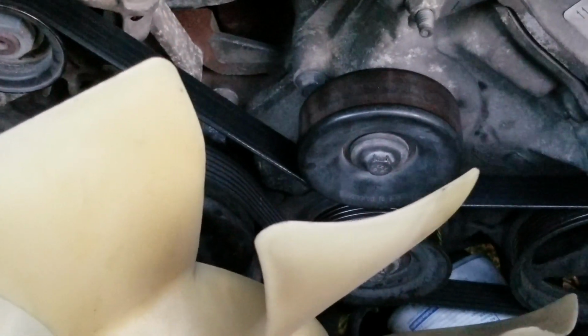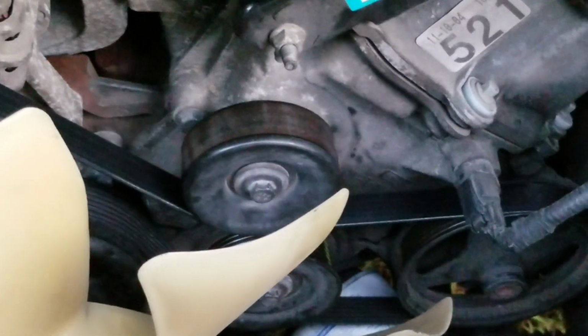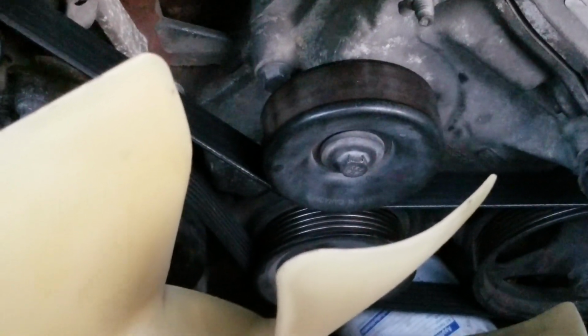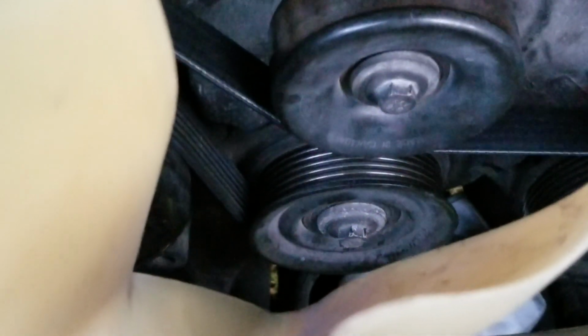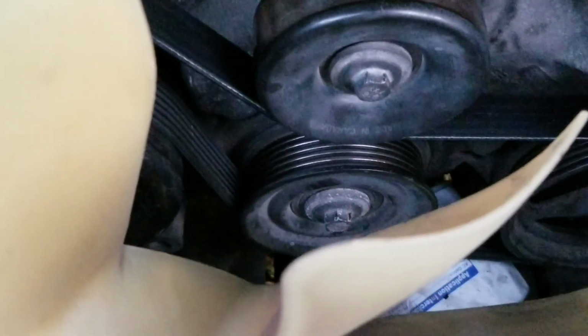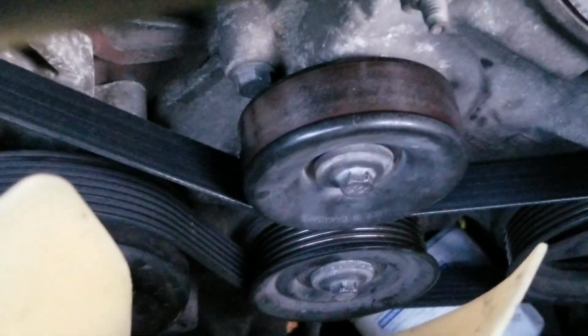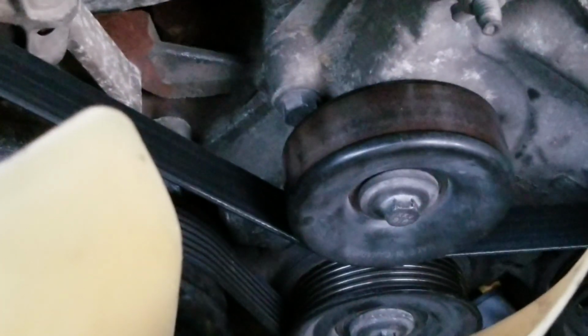But what I was going to say is, if you find a little shorter belt, like a 79, then you can take the idler arm pulley, because all these bearing races, that pulley and that pulley, all have the same size bearing seats. And the bolts are all the same. So you can interchange those pulleys, because that pulley's a little larger than those. And notice that's an outside pulley and that's an inside pulley, so that's the inside of the belt, and that's the back of the belt.